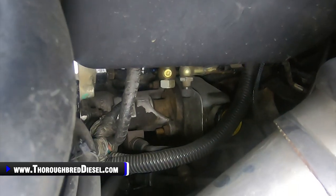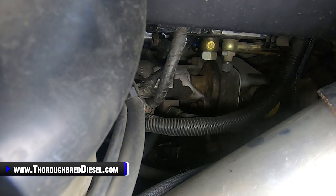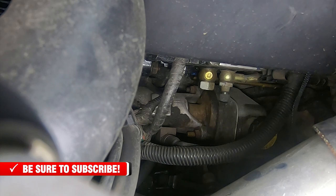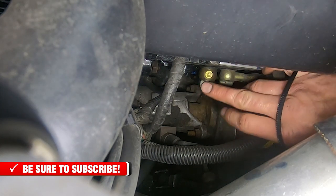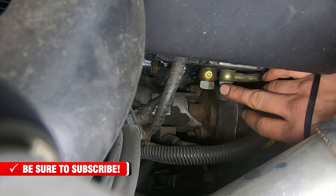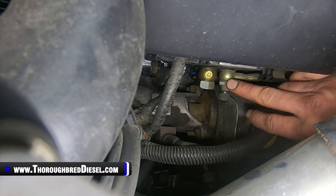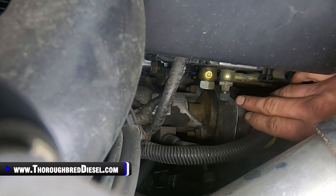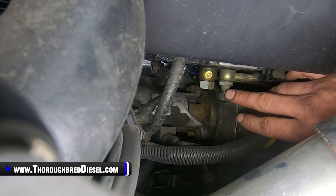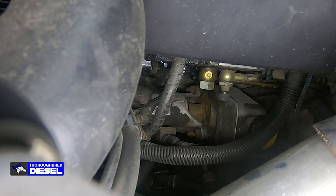In this shot, you see both of the lines that are the fuel feed and the fuel return on the VP44. This is your return line here on this banjo bolt, and the line behind it is actually the feed line or the supply line. Now on some of these 01 and 02 trucks — 2000s as well — you'll notice this is a little Schrader valve fitting. This is the one we're going to replace. The supply fitting for the VP44 is always the second one back, or farthest from the radiator. So this is 11/16 — we're going to loosen this.